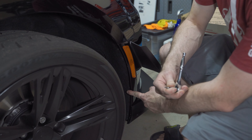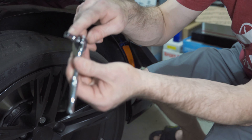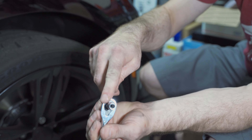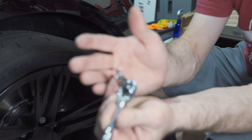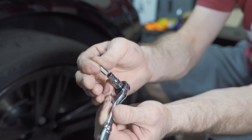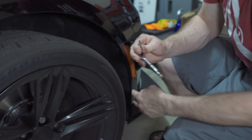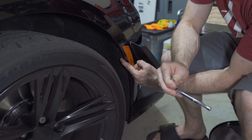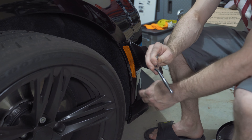To get these out, you're going to need a T-15 Torx. I'm using basically a quarter-inch socket, and that holds my T-15 Torx perfectly, unless you already have socket Torx bits — this is how I'm doing it. You've got a little screw right here and a little screw right here, and that's it. We just need to take those out and I'll show you the rest.